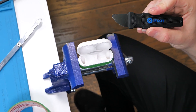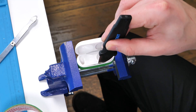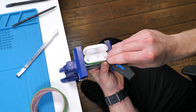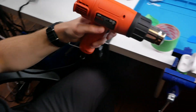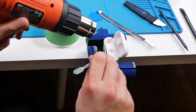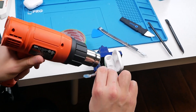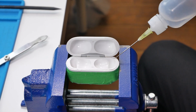It's prying time. Our boy Jimmy is such a useful tool when prying into these AirPods. These things are built like tanks. But this vise clamp is putting so much pressure on the AirPods that it's doing most of the heavy lifting. We're going to have to pry each side ever so slightly until the core of the AirPods kind of just pops up. A tiny bit of heat helps, but too much can burn the case, so we have to be really careful. Apple uses crazy strong glue — I want to know where they buy this stuff. But with some alcohol, it's nothing we can't handle.